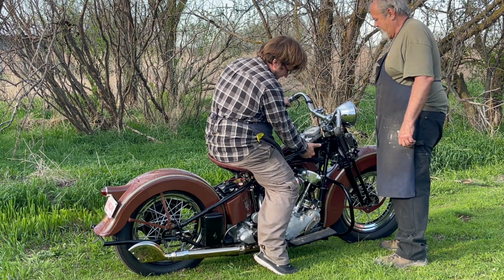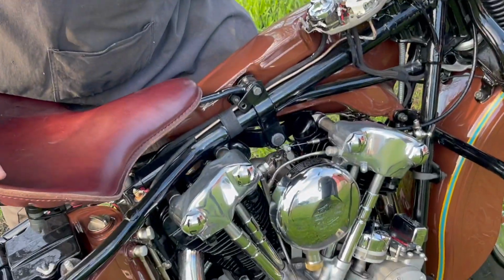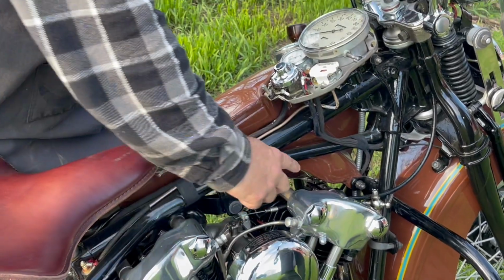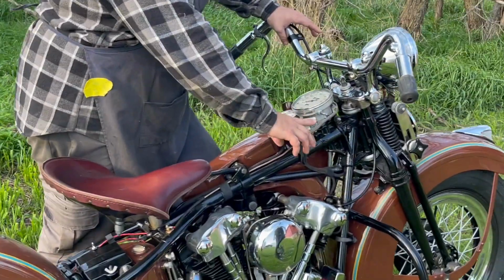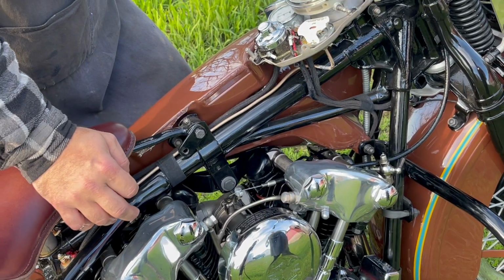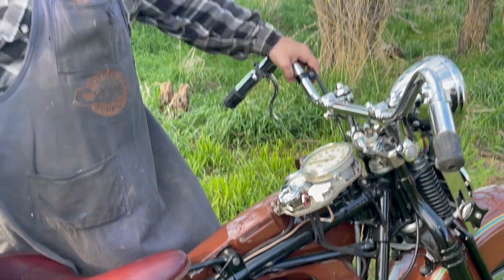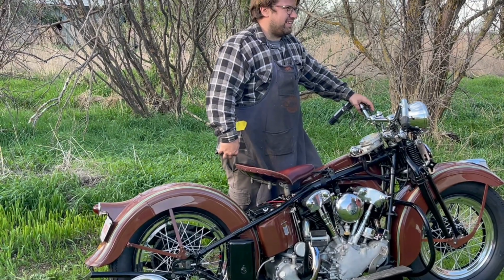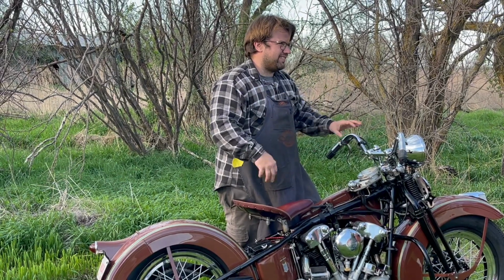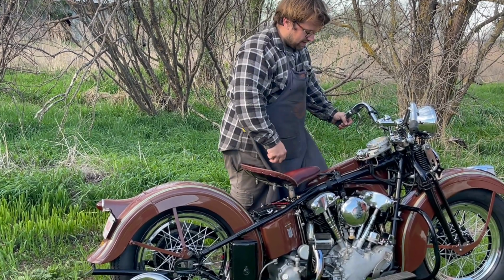That's where the oil was coming from. Hey, can you explain to me what happened? Okay. Well, we just started this up to try to figure out which rocker needed to be adjusted. And I'm sure one of them still needs to be adjusted, but we found the biggest oil leak. And the biggest oil leak was actually the oil pressure gauge. This is a 36/7 only part. And it was leaking out of the little diaphragm flipper area. So we're going to have to take that off. But I'll fire it up real quick for you just so you can see how a little bit of oil ends up looking like a lot. And all liquid wants to go down, so I think the over-oiling head problem we had was actually the oil gauge. We wouldn't have found out unless we had taken this off.